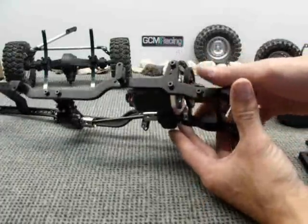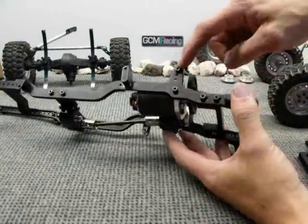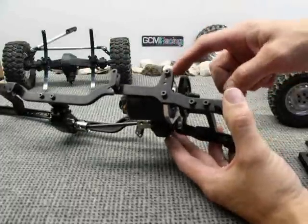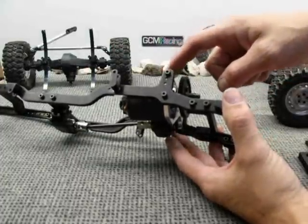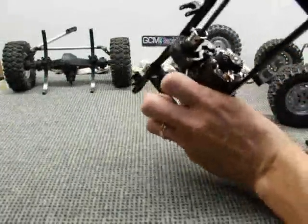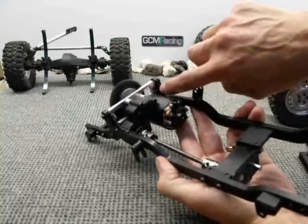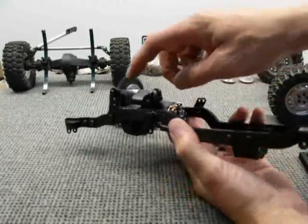In the front, you can mount your front shocks in any one of three positions. If you use the top one, which also holds the motor mount, you can simply run the screw all the way through the shock into the motor mount. Or there are two positions below, and there's clearance in the frame on the inside so you can put a small nut to hold the shock mount on the inside if you're going to use one of the lower two holes.